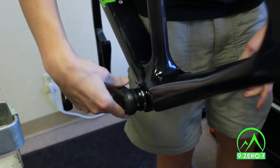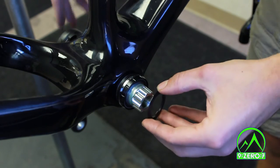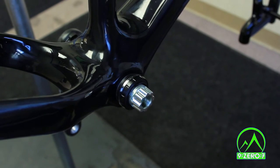The spindle may fit tightly — this is normal. For the drive side of the bike, prepare the spindle by installing a bearing shield, followed by a 1mm spacer. The flat side of the bearing shield should face outward and it should be tight against the bearing cartridge.